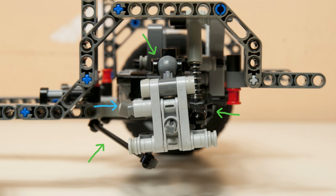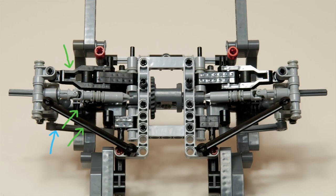The front arm is here to provide steering to the suspension when it gets compressed. In the bottom view you can see how the lower two arms are positioned in a triangle. In a real world setup the pivot points on the wheel side would be closer together.